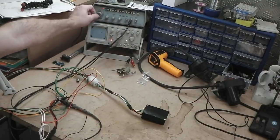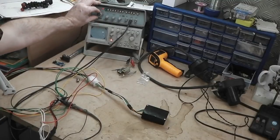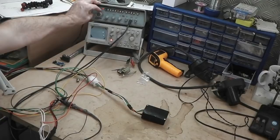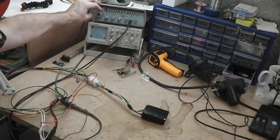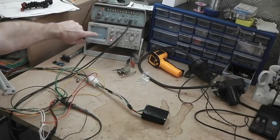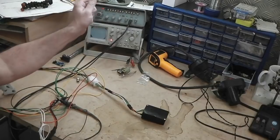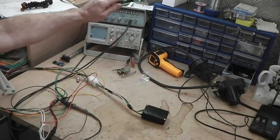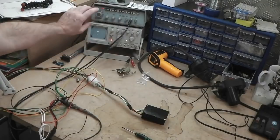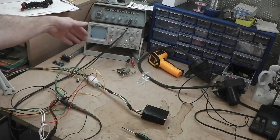And this dial here, the famous knob, that always opens up for jokes, doesn't it? So we can turn this, and that simulates the shaft of the gearbox getting faster. This can go faster, which increases the speed of the 12 volt. So remember, we talked about this, all that's doing is going 12, 12, 12, 12, and as I turn that, 12 really fast. But it's not actually 12, it's a signal of about 9 volts, but it doesn't need to be 12 for what we're doing in real life.